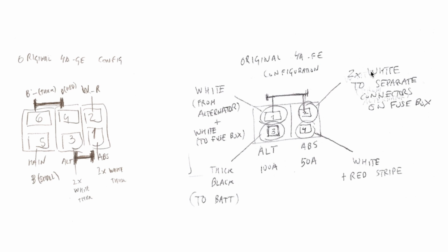It's important for you to understand these meanings, and I know that this comes from the alternator and this comes from the battery, because I use my multimeter to see which contacts. I would plug one terminal of my multimeter into the positive cable that goes into the battery, and the other terminal into the end of this wire over here. If it beeped, I know that there is a circuit there. Do the same, take your time, and you will see with the wires on your side that this explanation will make sense to you. I hope this is not too much confusion.